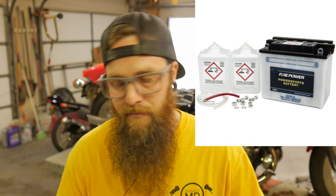This video is not telling everyone to swap to a lithium battery — I don't agree it's worth every dollar. I don't own a single bike with a lithium battery and I'm not going to. Maintenance-free batteries are fine; I really think the health and longevity of the battery — besides leaving your key on — comes down to how the battery was prepped: low voltage for a long range, 10 to 12 hours at 1 to 2 amps. AGM or gel acid-style batteries are awesome and I've seen them last 7 to 10 years. If you live in a cold climate, lithium batteries still aren't a great choice — they don't do well in temperatures under 40 degrees.